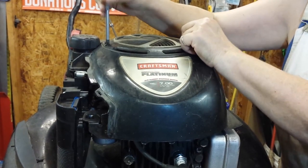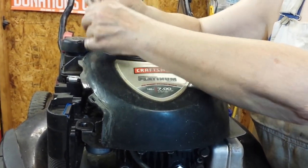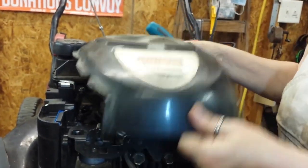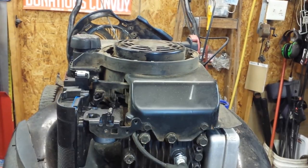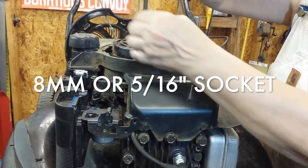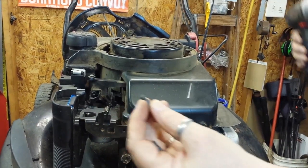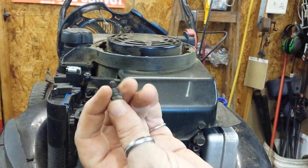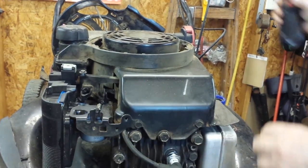These two Phillips screws come out. They are going into plastic, so when you put it back on you don't want to do it too tight — there's a plastic ring right there. And these shoulder bolts: you can see why they're called a shoulder bolt. If you lose them they're kind of hard to replace at your hardware store, so don't lose them.